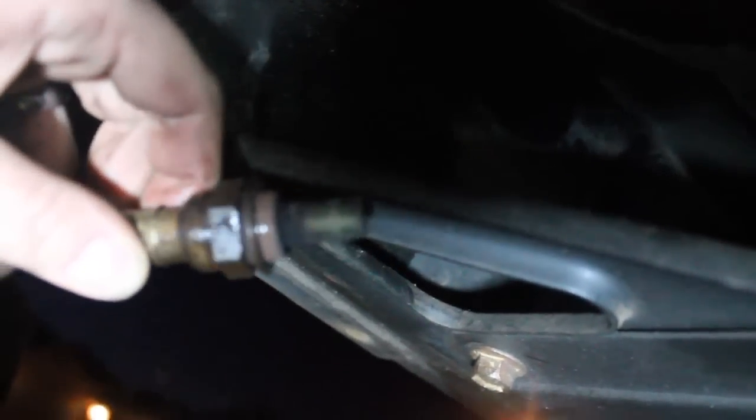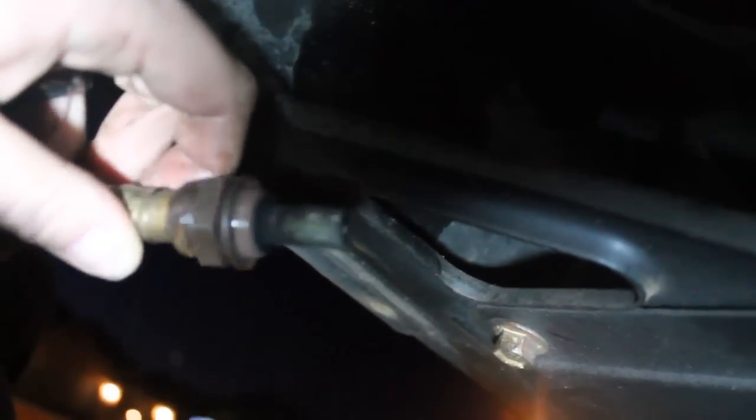After a little bit of finagling with just a ratchet on that same socket, we were able to get that O2 sensor out. Here's our quarry — the other side should be a little bit easier than this. In your case you're probably not doing two, just the one. This guy does look a little worse for wear. You can't say for sure just looking at it — ideally you'd do a voltage test or something like that — but I'm pretty sure that the sensors are the cause of failure here.